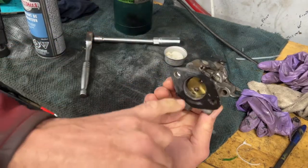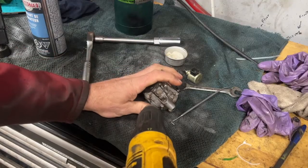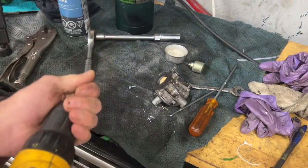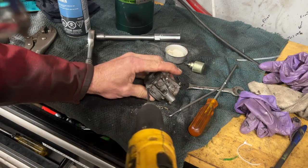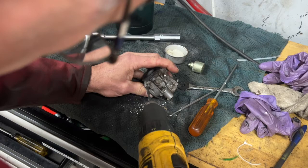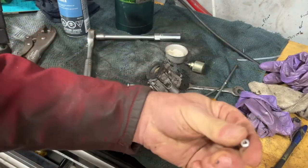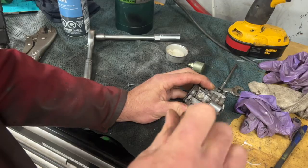The other thing is, I'm going to take this plug out — this is where you adjust your low speed idle. So I'm just going to drill a little tiny hole here, then take a bigger drill. There you go, it just popped out there. It reveals a screw right there so you can adjust that. I'm going to turn that half a turn out.